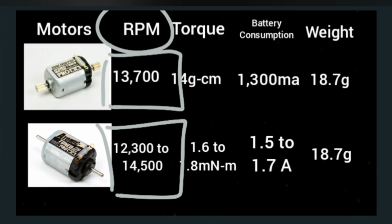Because double shafts have more gears to push, they have more power, and they're more direct when it comes to their gear build compared to the single shafts. But they do have a lesser top speed, and a lot of torque. And single shafts have more top speed, which is RPM, with lesser torque. Yeah, keep that in mind.